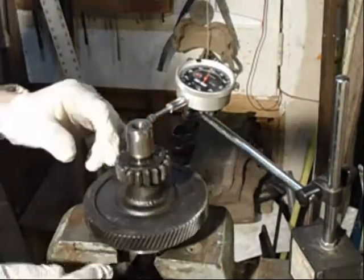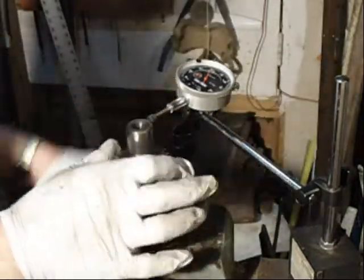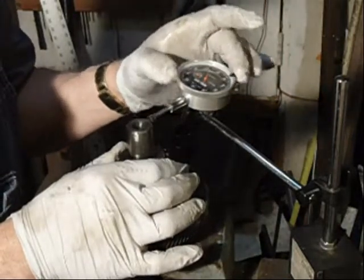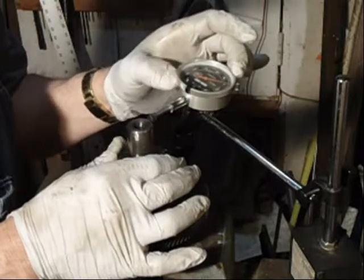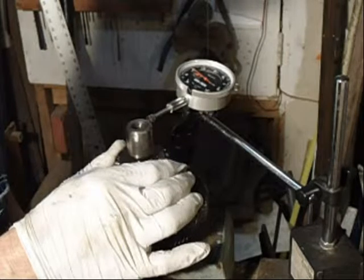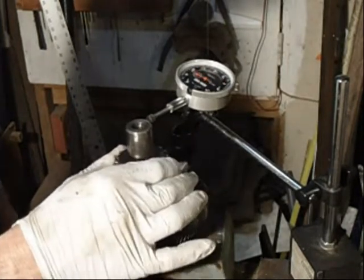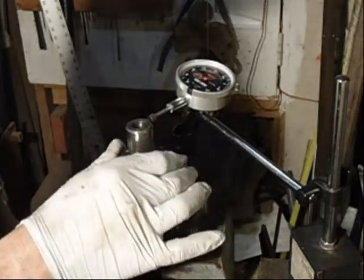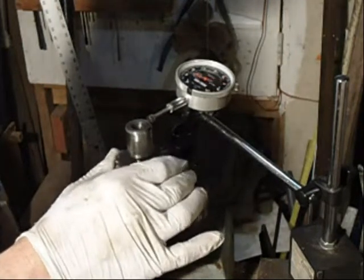This is the main idle gear. What I did is I clamped the bearing and put a dial indicator to it, wiggle it back and forth to see the extreme movement. Set it at zero — we're looking at 10, 20, 30, 40, up to 43, 45, almost 49, 48. That's like one of the worst ones I've ever seen.